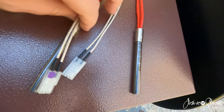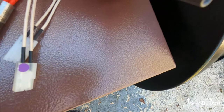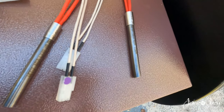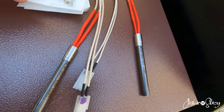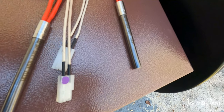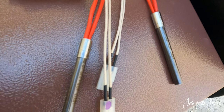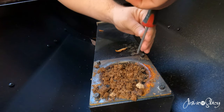This is the kit I ordered from Amazon. It actually comes with two hot rods, and I think these are a touch bigger than what's in here. It also comes with two fuses to replace if you need to. With no ignition coming to the wood pellets, I believe replacing the hot rod is going to fix our problem.